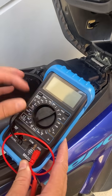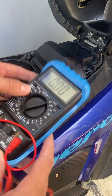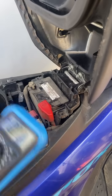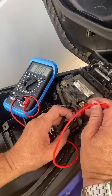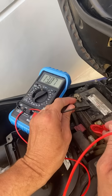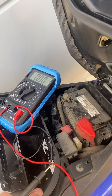I'm going to set my multimeter to 20 volts DC and turn it on. Then I'll remove this cover — it just had two screws on it. It shows the plus and minus terminals. It's reading 13 volts. Now I'm going to start the bike — I need it off the stand.